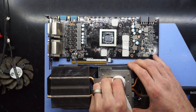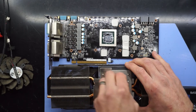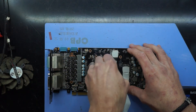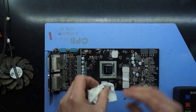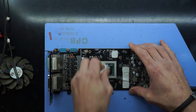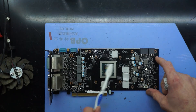Now with the cooler mostly back together, let's put some new thermal paste on here. I'm just using a cloth with some isopropyl alcohol on there just to clean it up. This is definitely going to help lower the temperature of the graphics card, especially with the original thermal paste previously being on there — this will give it a bit of extra life, or at least prolong its life. Cleaning the thermal paste on the actual chip itself is a little bit harder, as you do have to be a bit more careful. What I typically use is a toothbrush — just an old toothbrush — spray it with isopropyl alcohol and give it a light scratch around. That should clear off the vast majority of the thermal paste that's stuck on there.